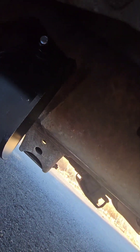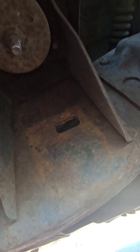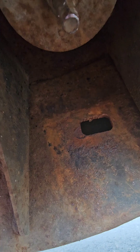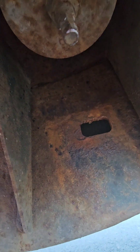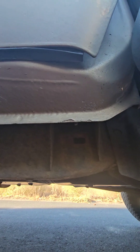I couldn't put the Nerf bar under here and then reach under, so I took it apart — it gives me some room to work. Now I'm going to get the Nerf bar underneath here so I can tell which of these holes at the back needs to have that other one in there. It makes sense — it's going to go where the old one was, right here, which there's another body mount right there. It's 64 inches from the front one, center to center. And you just have to reach up inside of here with your bolt and washer and then put the hardware on there. As a reference point, it's right where the box begins, straight underneath there.